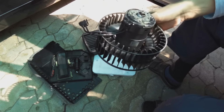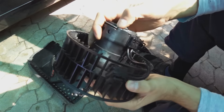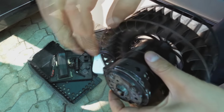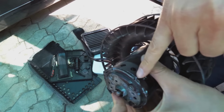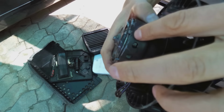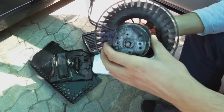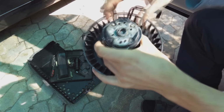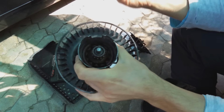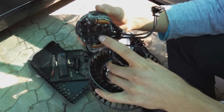Now, to open this motor, there were lips on each one of these. I don't know if you can see in the camera here. Yeah, I needed to get the back of this motor off, so I ground down each section here with an angle grinder, and then I used a screwdriver and pulled this cap off. And included in the cap, let's get it out, there we go, that's inside the motor. Now, included in the cap are the terminals and the brushes.